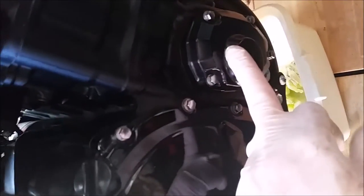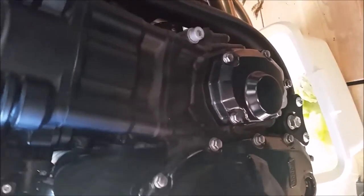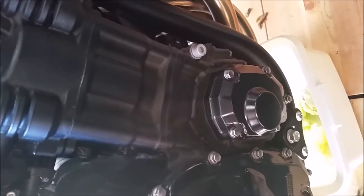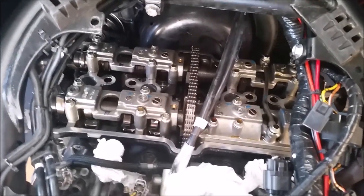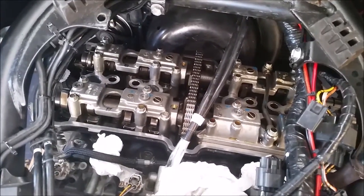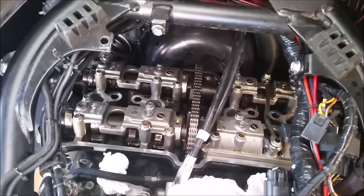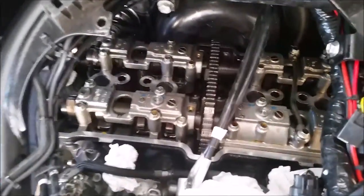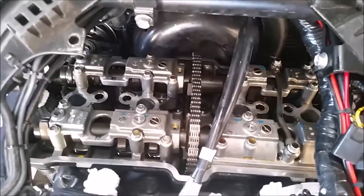There's my right-hand engine casing that's got to come off next to give me access to the end of the crank so that I can rotate the camshafts to give me the desired readings. That's the rocker cover removed — not a lot of room to get that out of there, to be honest. I had to remove the PAIR reed valves on top of the rocker cover housing which made it a bit easier, but even so, not a lot of room in there as you can imagine. Anyway, we're on to the next stage, which will be taking readings on each individual valve and recording the measurements.